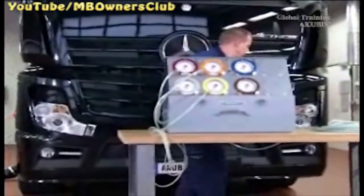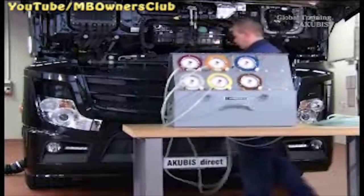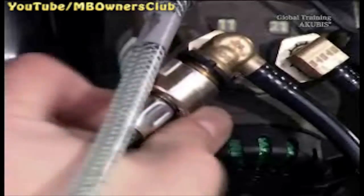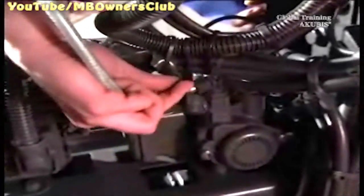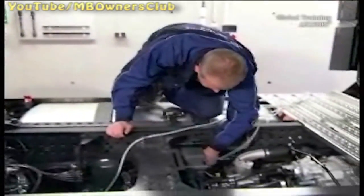Then connect the test case to the four air circuits. The supply circuit for the front axle brake is connected to test connection 12 of the brake power sensor. Then connect the supply circuit of the rear axle brake to test connector 11. Now connect the test connector to connection 11 of the trailer control valve, and connect the supply of the trailer and parking brake. Also connect the tire inflation connection of the EAPU to connection 28, the supply pressure.